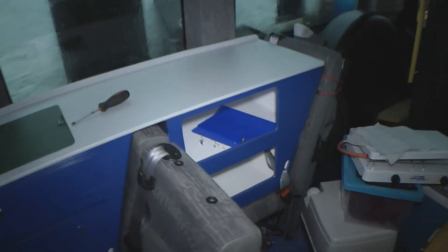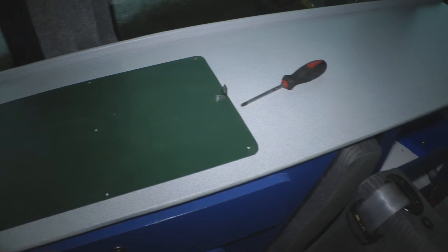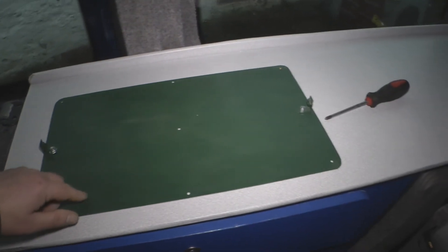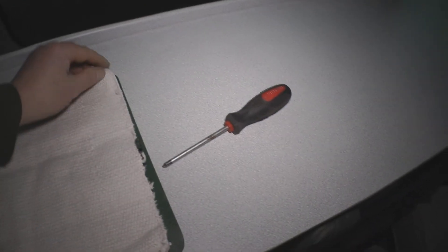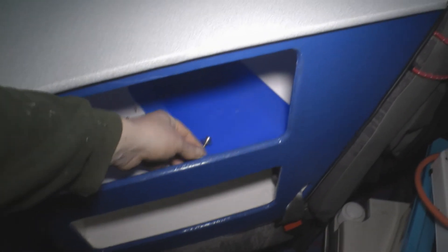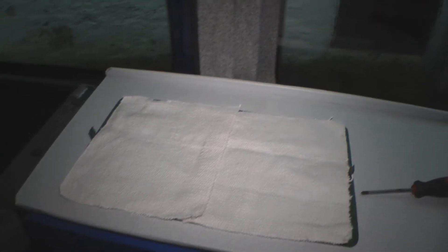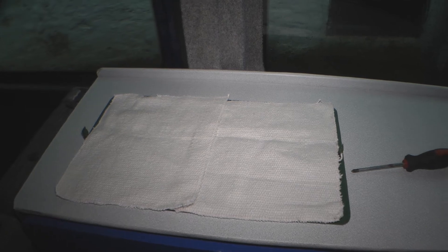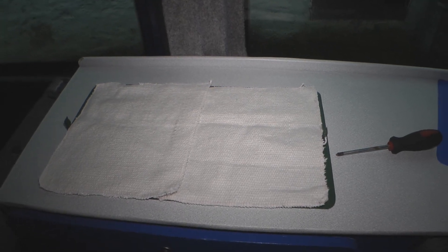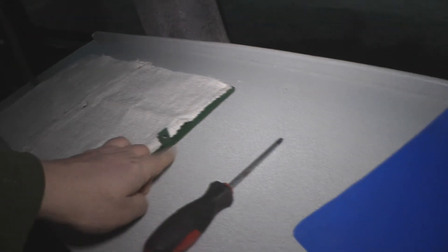So it's all fastened in place. I'm just getting on and sorting out where the hob's going to sit — I've screwed through the worktop and got these brackets fastened on, so that plate is now bolted through the worktop. I ended up getting two of the plumber's mats, so I'm just going to add them and stick them underneath. Thanks Glen for that suggestion — I decided I'm just going to keep the silicone mat just as a worktop protector and use the soldering mats underneath the stove to stop the heat getting to the worktop. And that's the heat mats fastened down. So next I'm just going to put the stove on and bolt it in place using the brackets I made up.